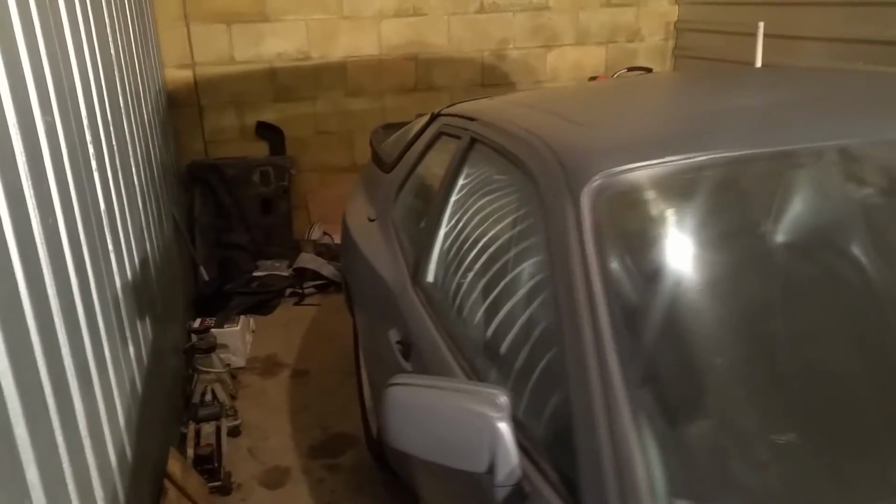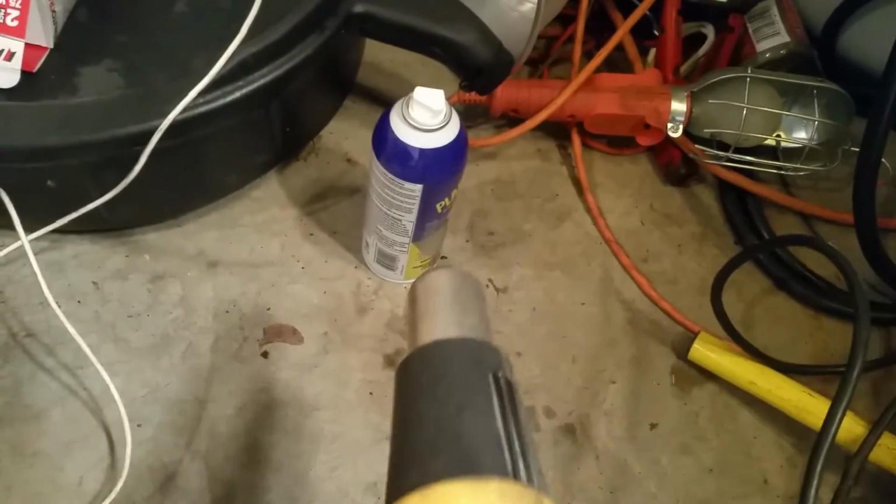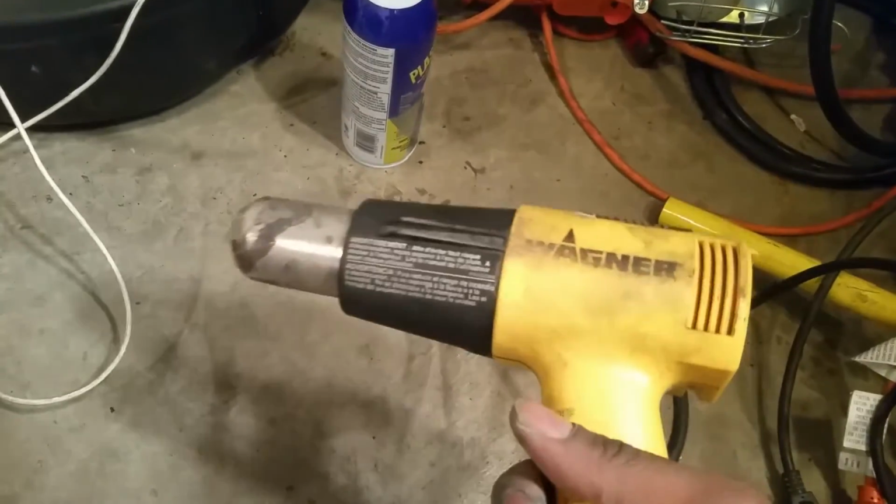Here's some of the work around the side. Again, this is the base coat with the gunmetal. And we're just moving it along. I haven't done these fenders yet necessarily. There's still some base coat paint on that, so don't worry about that. And here's the other side of the car, okay? So we're making progress. We're going to continue to spray the hood, but I want to point out that you want to keep your product warm. One thing that I always use, right on the bottom of it as I'm shaking it, is my heat gun to heat up the product so it sprays really fine.